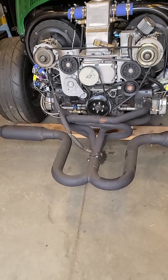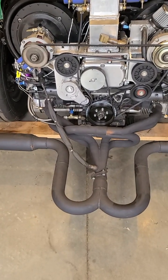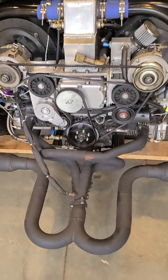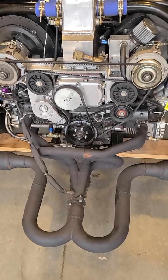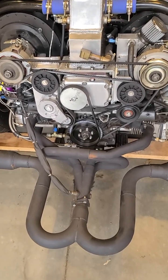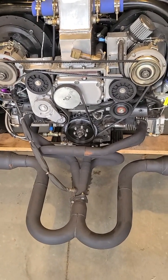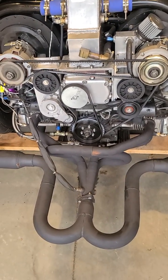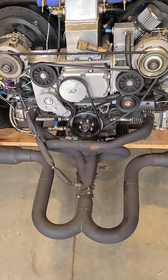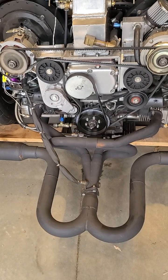So I had an idea. Based on how Ecotech does it — totally differently — when you have two cylinders that are opposing and you are in wasted spark mode, the one that has compression versus the one that's on the exhaust stroke, one of them fires just a few microseconds before the other. So I figured if I could pick that up and turn that into a cam phase signal, then I wouldn't need to figure out how to physically detect the cam phase.